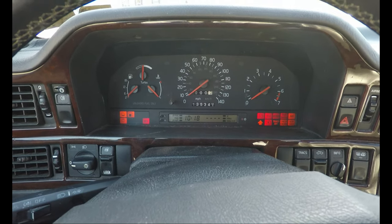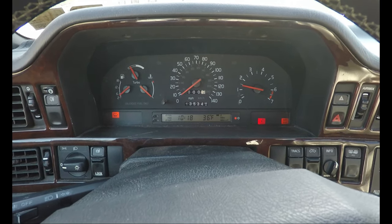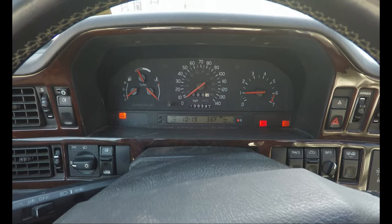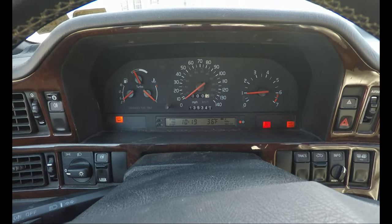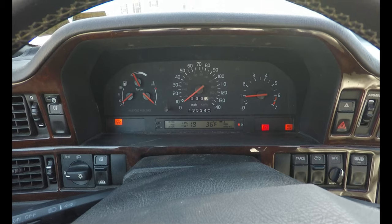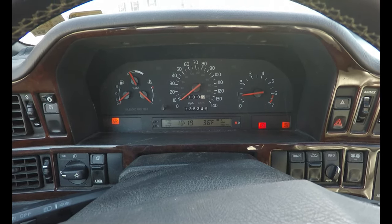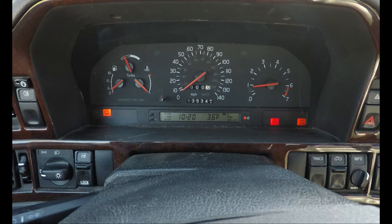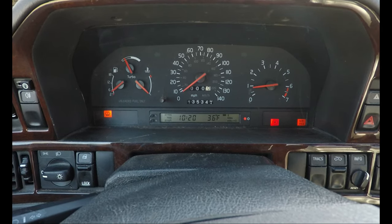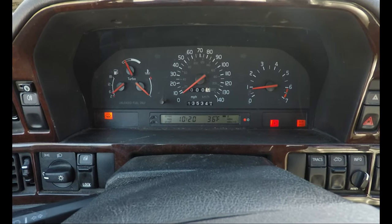It kind of starts right up. We have a couple lights on — service, coolant level I'm guessing, and washer fluid — nobody cares about that. I did notice that it starts up, idles fine, and then it'll almost want to die, and once it warms up it's good again. It must only do it for a very minimal amount when you first start it, but yeah, it'll almost die and then rev way back up to compensate for the drop in RPM. I have no idea what that's about.